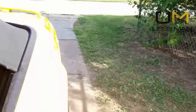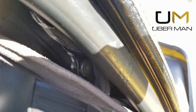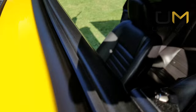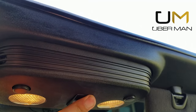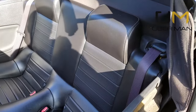There's another thing I want to show you about convertible tops. If your convertible top ever starts whining a little bit — back in here, right there in the middle, and all throughout the top you can see I cleaned this lip thoroughly too. All throughout here, very clean. Throughout your entire convertible top system there are all of these hinges. What you want to do is raise your top approximately 50% of the way up. Mine was whining pretty badly, and that can be a sign of low hydraulic fluid.